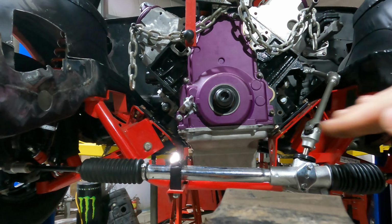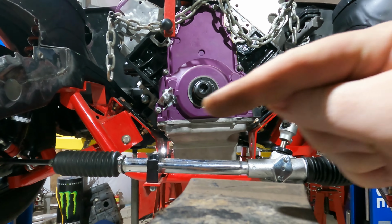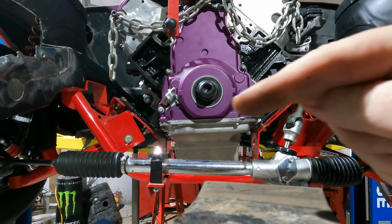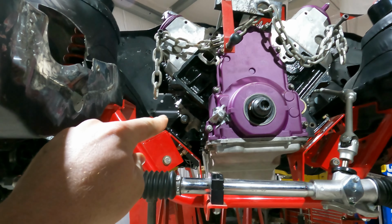So these guys are the guys who made the original torque arm and transmission mount that didn't even come close to fitting in this car. And now they gifted us with this. So, as I said, the car is level front, back, side to side, but you can see here the motor isn't. It's on a 5-degree angle downward to the passenger side, which equates to almost an inch at the motor mount